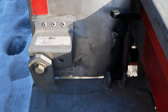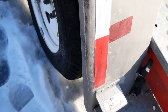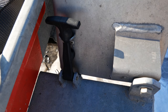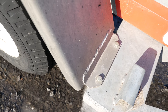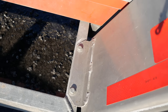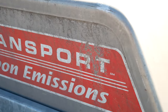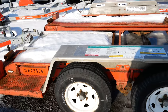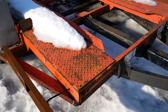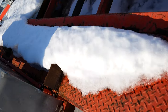One other thing: the fenders on the driver side fold out with a rubber strap. That's nice — if you drive the vehicle on, you can open the door and get out without climbing out the window or out the back hatch. On the passenger side, there are seven bolts that can be removed to take that fender off the trailer if you back the car up and don't want to climb out. This trailer is used to transport storage pods — you can tell by the rollers in the exterior frame. You definitely cannot transport a vehicle on this setup, so if they try to give you this one, run from it.